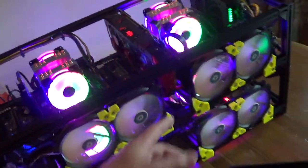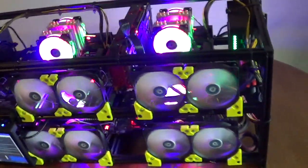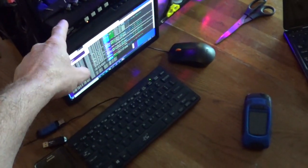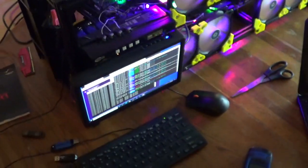That's calculated by Open Hardware Monitor. I have a Vega 64 on here, but ignore that — that's just for virtual reality, since these are basically super high-end gaming rigs. There are some minor wiring changes on the power supplies: Power Supply 1 provides the 12 volts that runs the monitor and the 4X multiplexer. I also put a common ground wire between every power supply.